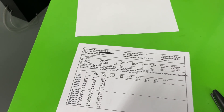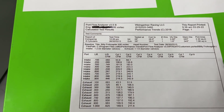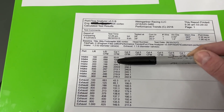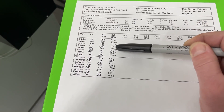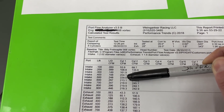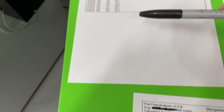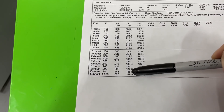What does an actual 906 stock casting flow? Cylinder 1 here is the stock 906 casting without a hardened seat — it's a pretty good example. It flows 204 cfm at 0.400 lift, while the Speedmaster flows 206 — so it's slightly better at low lift. But at 0.500 the stock 906 went 229, while the Speedmaster is only 208 — so the stock Vortec is better from mid-lift on up. On the exhaust side, at 0.400 the stock 906 is 131 compared to 128 on the Speedmaster. Note: the last exhaust number includes an exhaust pipe; all others are without.